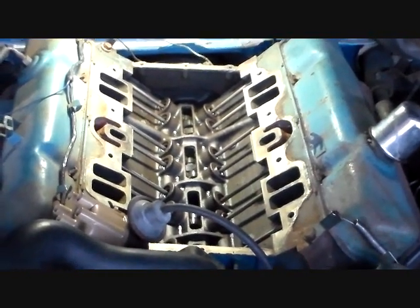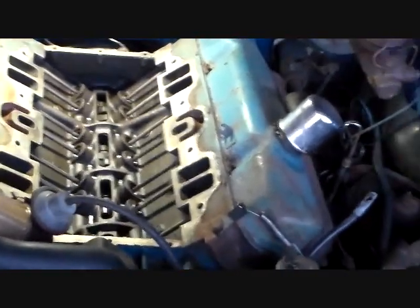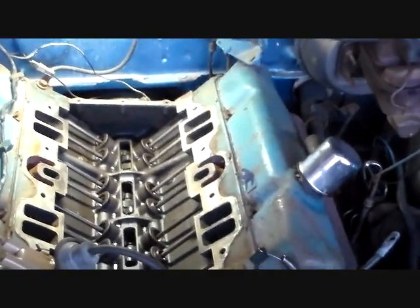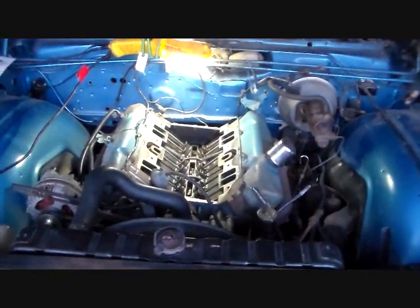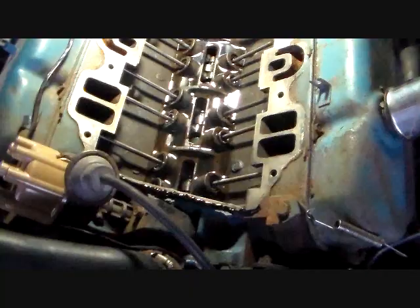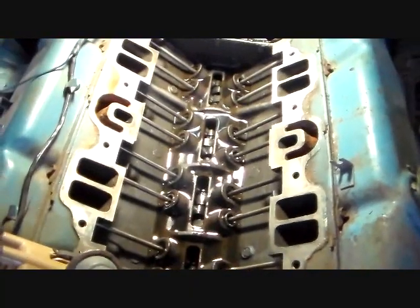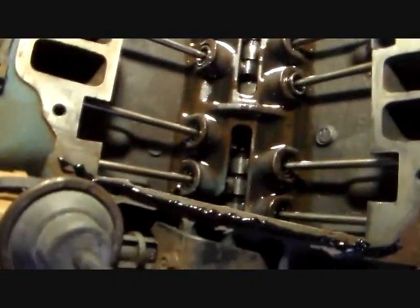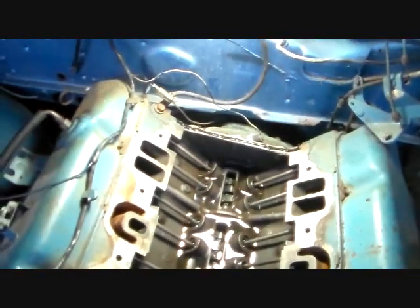So in the meantime I'm going to clean some more bolts up and get that ready. I'm going to go ahead and take some oil and drizzle it on that camshaft because it's been sitting a good while and all the oil has drained back off. I'm going to change the oil anyway before I try to crank this thing for the first time. Camshaft and lifters oiled. RTV applied. Just like that — that's what you do.